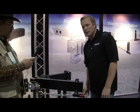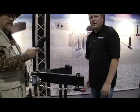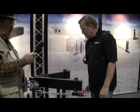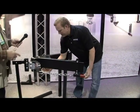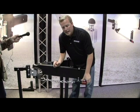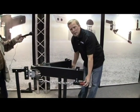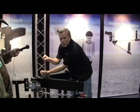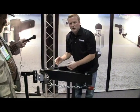We're excited about this hitch. I'm going to show you how the chain system works. These are urethane springs used in the automotive industry for stamping out metal parts and forming fenders and hoods on cars — they can go through millions of cycles without hurting the urethane spring; they last forever. What we're doing with the chain is instead of lifting, we're actually pulling on the bottom of the ball here. With the chain attached to this plate and this spring, we compress it about a quarter of an inch, which applies about 2,000 pounds of pressure. With both chains, we end up pulling the trailer forward with 4,000 pounds of force, which twists the hitch head and transfers weight to the front tires of the vehicle, doing the weight distribution.